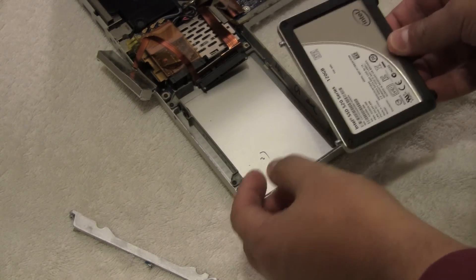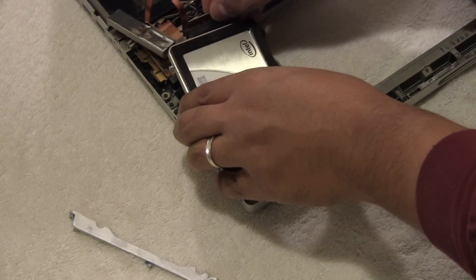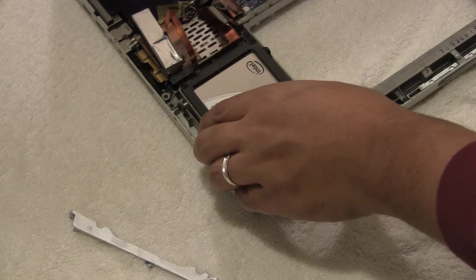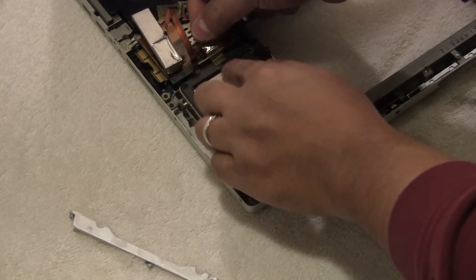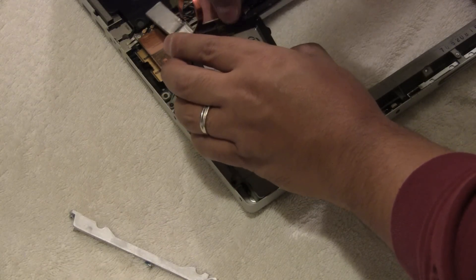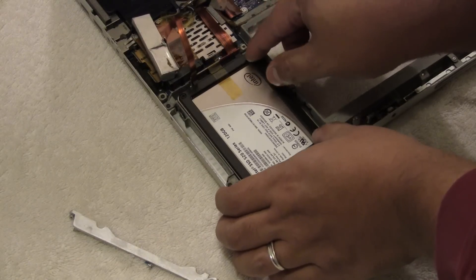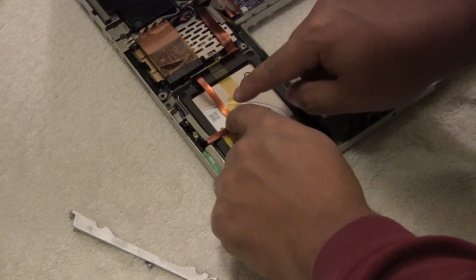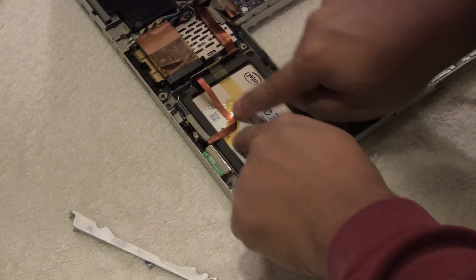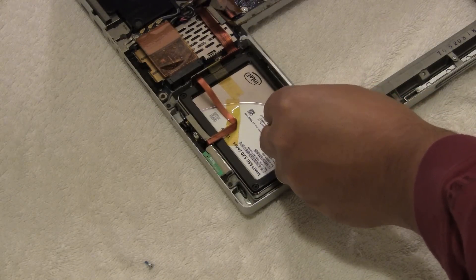The hard drive is now ready to go. I've transferred the contacts from the old drive onto the new solid state. Now do everything in reverse: connect the drive to the cable — be very careful not to break any cables, it should slide right in easily. Then take the tape, apply it to the new drive, wrap it around and make sure it's secured. Insert the drive, replace the sensors, apply the tape back, then install the securing bracket.